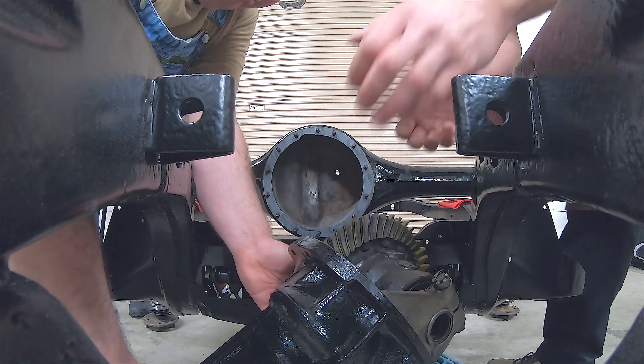Note the orientation that we have — we do have the rear end upside down. So you want to have the two holes for the calipers towards the rear of the car and cocked towards the top of the car. We're showing you right now with it upside down. So right here, we've got our studs going through, and we're going to go ahead and put the rear end in. On the axles, we have new bearings pressed on, also available from Caddy Daddy, and also the seals. This right here is going to go right up against the bracket, and the shape of them is going to be the same as the shape on the rear end, so that flat spot is going to go towards the top of the rear end.